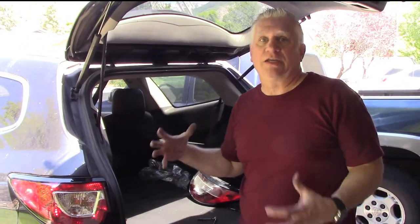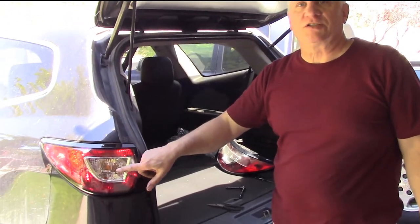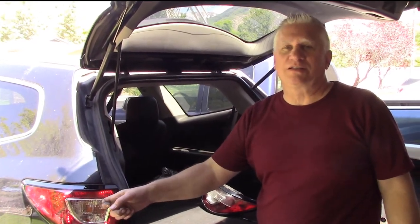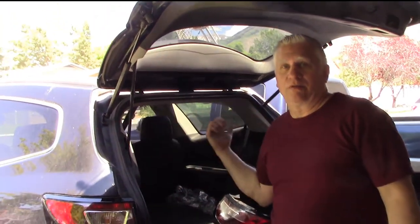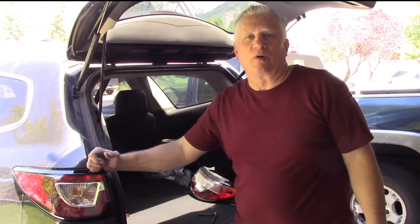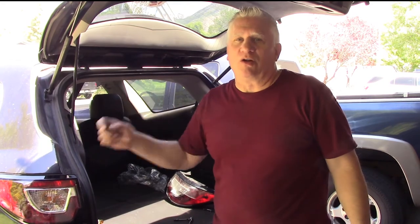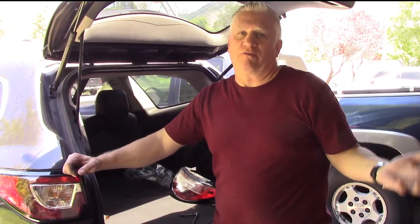Successful swap out of both the driver's side and passenger's side complete tail light assemblies. One thing I learned: if the seal breaks and you do get condensation on the inside, don't tap on it — because then you've immediately lost 180 dollars for the replacement times two if it happens on both sides. We have another Dodge Caliber where the taillight filled up with water and the blinker started doing weird stuff. In that case we just drained out the water. In this case, since somebody broke the lens, I couldn't put a little hole in it to let it dry out.